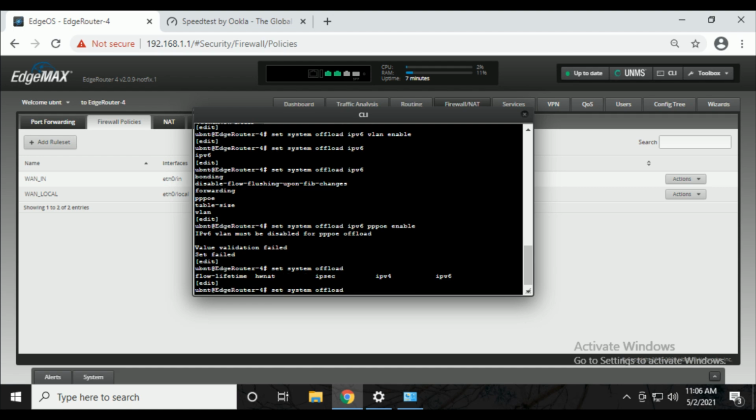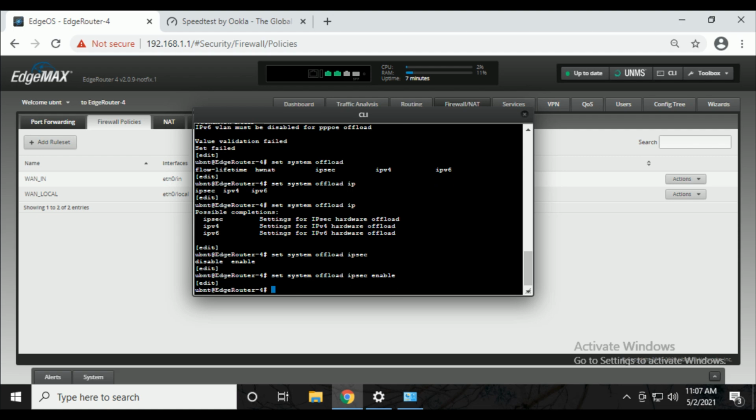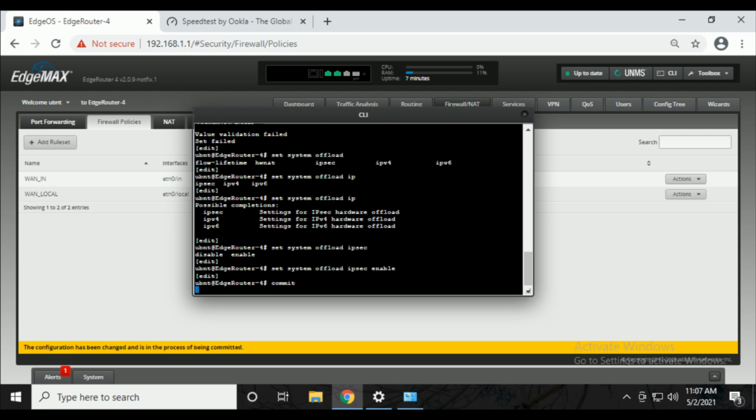Now we're going to see which one of these we missed. Okay, IPsec enable. So set system offload IPsec enable, and that should be all of our offloading commands. Now, where the Edgerouter-X we only needed 2 of these commands, on this one we needed all of those to enable all of the offloading features. And there will be a link in the description below for all of these commands on UBNT's website. But for now, we're going to go ahead and commit that.